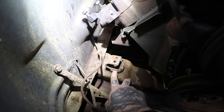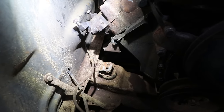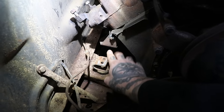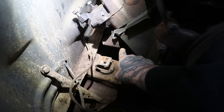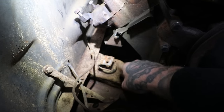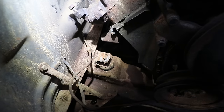I've used these before. My Cadillac engine sweetheart Roadster actually utilized those because they're nice and small. So what I'm gonna need to do is just adapt this. You see there's a gap here. Once we get this leveled, whatever that gap is, I'm gonna have to build some metal to kind of raise this up and get it over to there. So just some kind of tab to go out and around and drop it down. Or I may make it from scratch, I don't know yet.